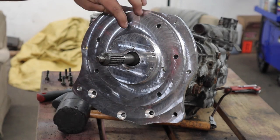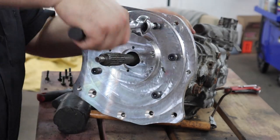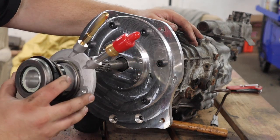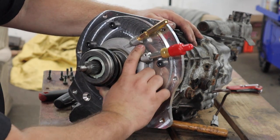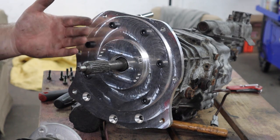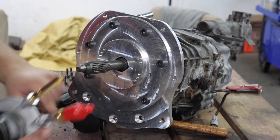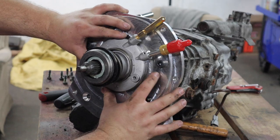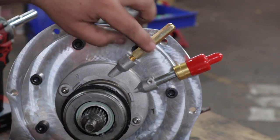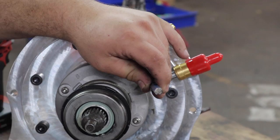We're going to use the six provided bolts to secure the adapter plate to the transmission. Here's the new throw-out bearing assembly. It says to clock it in the position most convenient for you — there are a couple of different pre-drilled hole settings. The starter is right here and it has to be above 90 degrees from it, so I'm going to use the two middle holes. I'll also need to drill a hole in the bell housing, and there's a retaining pin to knock out to swap the fittings.